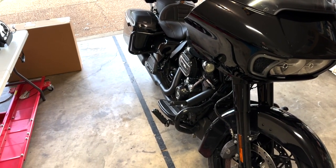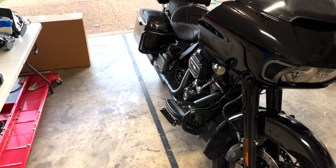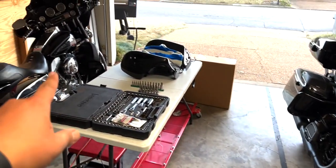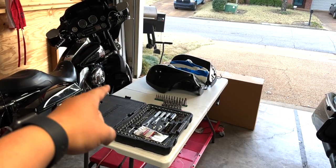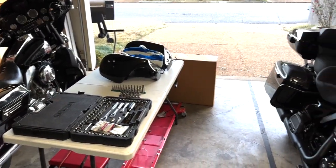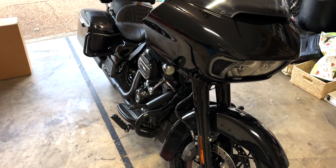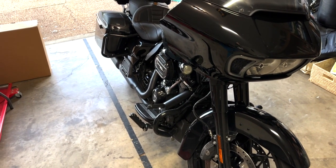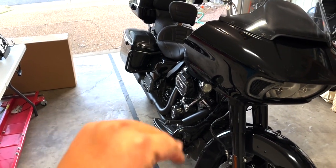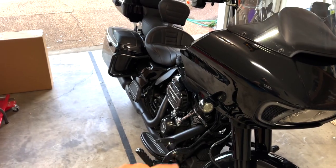It came with the chopped engine guard you see there. When it got cold last winter I started layering up and decided that lower fairings would be the way to keep wind and cold air off my legs — and it does great. My wife's bike over there has lower fairings too; hers are the Harley ones and I got Amazon ones just to compare. The reason these lower fairings were off from last season is because my engine was getting extremely hot, and I decided I probably couldn't run them in spring or summer due to restricted airflow.